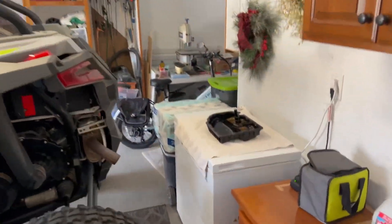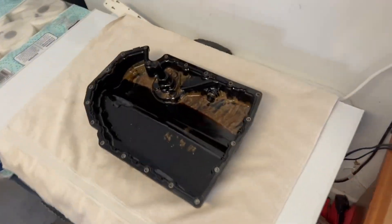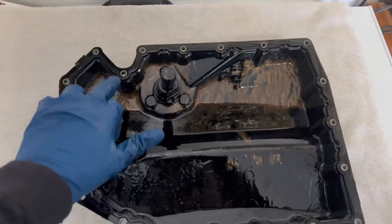So this is the weird thing — most likely I'm going to have a blown head gasket, but was that blown head gasket due to my own fault for not putting on the oil filter when I tried starting the car, or was that gasket going to blow anyway? I do not know. But I did find coolant in the oil, so come around here and check out the oil pan, guys.